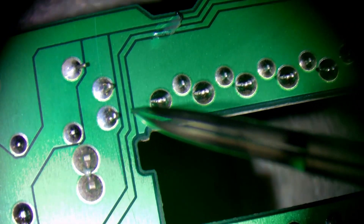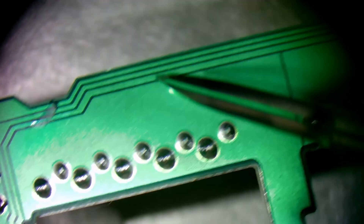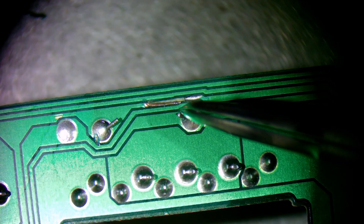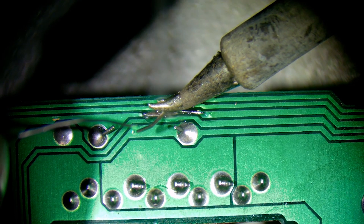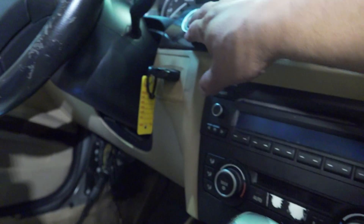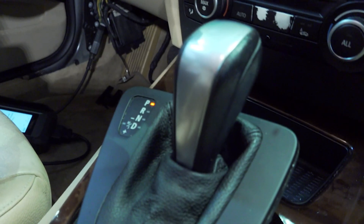We're going up here. This is something that I already repaired a bit — this was a hot spot that I had found. This was another hot spot that I found; it has solder mask all over it. And this is our full open circuit — you can see our full open circuit right here. Looks like we got ourselves a solid connection. I can see that my transmission is on. Key is on, everything's still looking good. We're going to give this the test of time, see how long it lasts before doing anything at all, because it could very well fail.